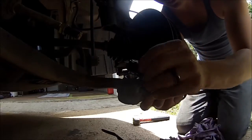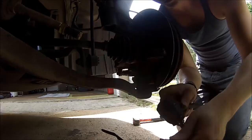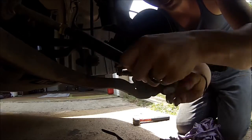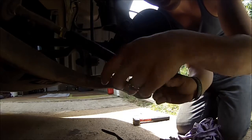The new one came with a brand new cotter pin and a brand new castle nut. What you'll do is tighten this up until it reaches that mark you made with the paint pen — no tighter than that, because you want to keep the same alignment you just had.